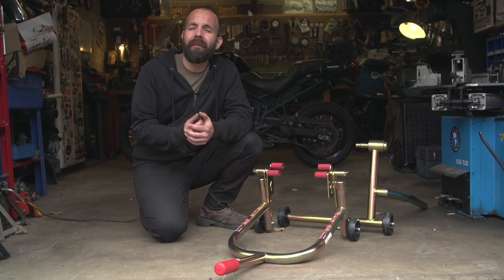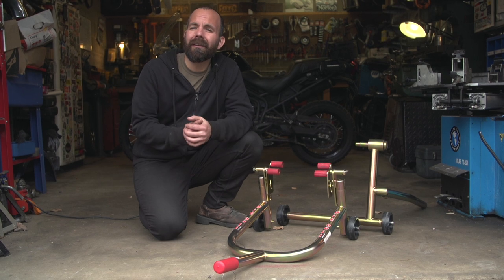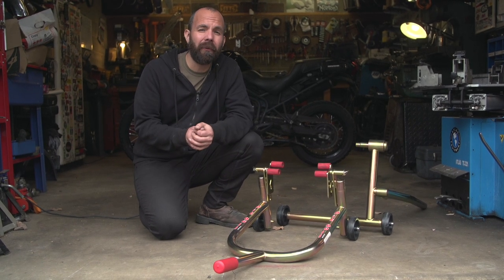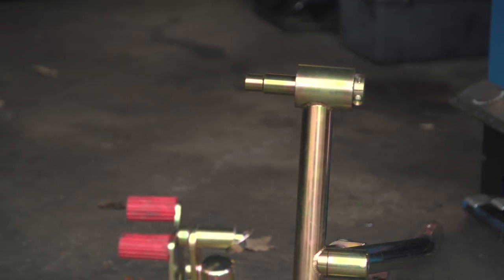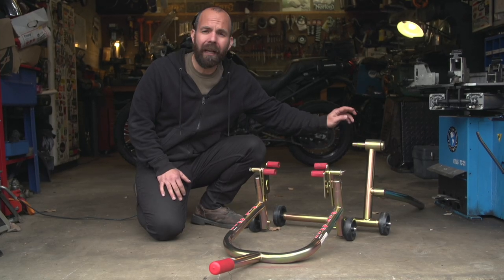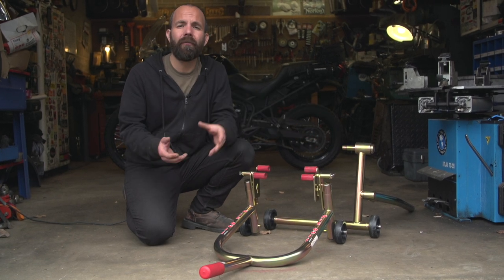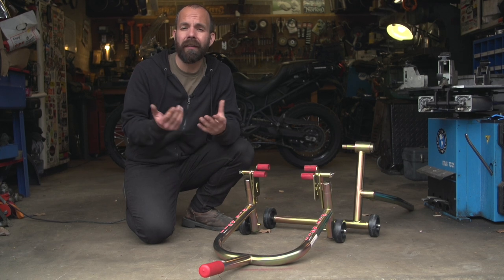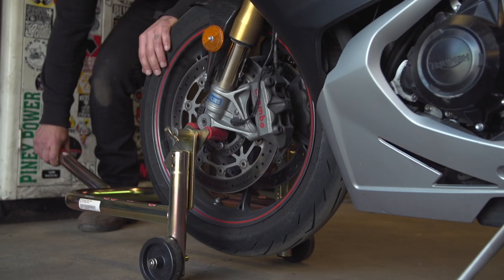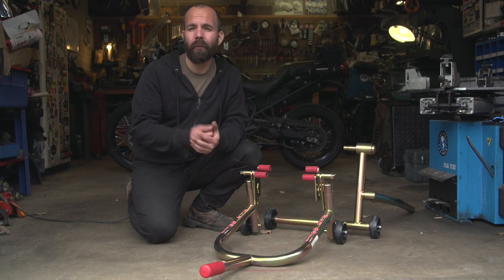Certain adventure bikes have a single-sided swing arm — the popular BMW and the Ducati Multistrada are just a couple of examples. That does make it a little bit tough to raise the bike, especially if you don't have a center stand. The last Multistrada I worked on didn't really have the best skid plate, so I ended up needing to use a single-sided swing arm lift. Pitbull offers one that's really awesome — they come in a variety of different pin sizes to fit different axles, and it's a great option for single-sided swing arm bikes. In conjunction with that, if you don't have a way to lift the center of the bike and have an exhaust system underneath not designed to bear the weight, a forklift stand is a really good option — these just go under the bottom of the fork legs and take the front wheel off of the ground.